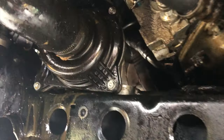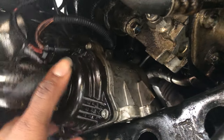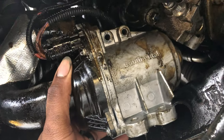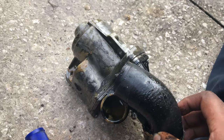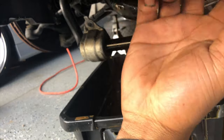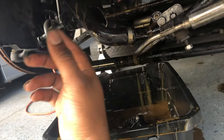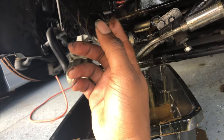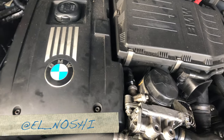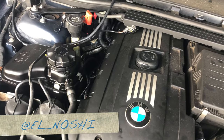It was just that one screw on the side — I removed it and the only thing left once I pull it out is to remove the power cord. It's out. The water pump is out right now — what a mess. I assume this is why the water pump failed in the first place, all this oil in the coolant. So that'll be pretty much it — just do everything in reverse and your car will be back up and running. In my case, I either have turbos with blown seals, or I'm hoping it's just the oil filter housing gasket that's leaking, because if it's turbos, that's a whole nother job.